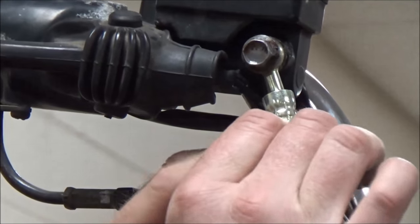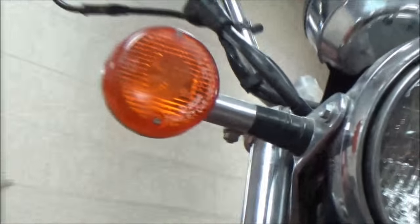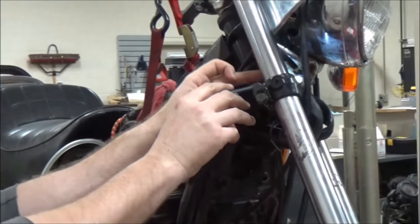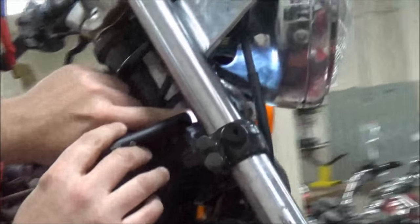What people really need to do is inspect the brake line fully — rubbing your fingers along it all the way down, getting your flashlight out, being able to see the whole pathway as it goes along the vehicle. You can see right here where it's wet — that's not right.